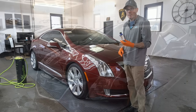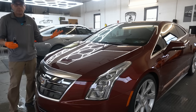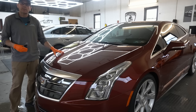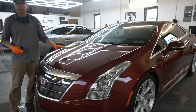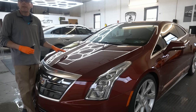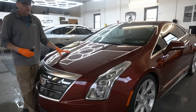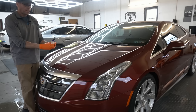Let me give you a quick demonstration. Preparation is key, and that's pretty much the saying when it comes to any detailing product. Preparation is key. So you're going to get the most out of a detailing product, especially a protectant, if preparation is done correctly: wash, decon, clay, iron remover, paint correction — at least a cleaner polish, even if you have to do it by hand. Preparation prepares the surface, gets it completely naked and stripped, and ready for the protectant.